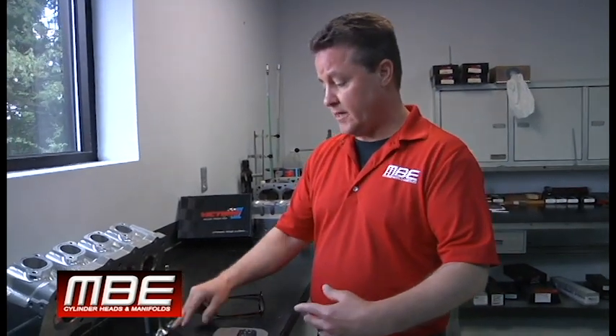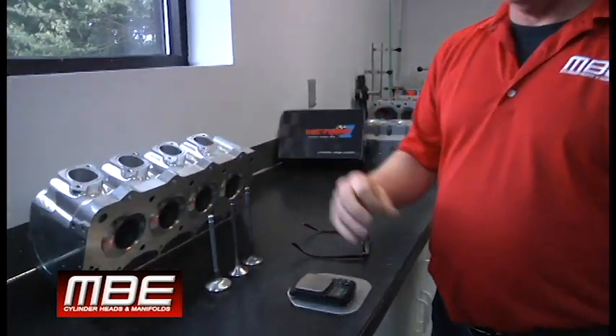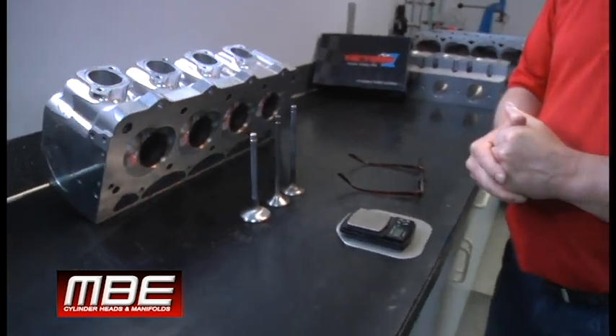The benefit of going to titanium is that if the valve is designed correctly — which is what we do, with the two-degree hub and everything — it will dissipate the heat, and it saves your lifters, valve springs, camshaft, and all those parts. That's why it's important in the right application to use titanium whenever you possibly can. To summarize: Inconel is the right choice for boats and gasoline power adders; anything methanol, run titanium — we've proved it works. That's your Inconel Valves 101.